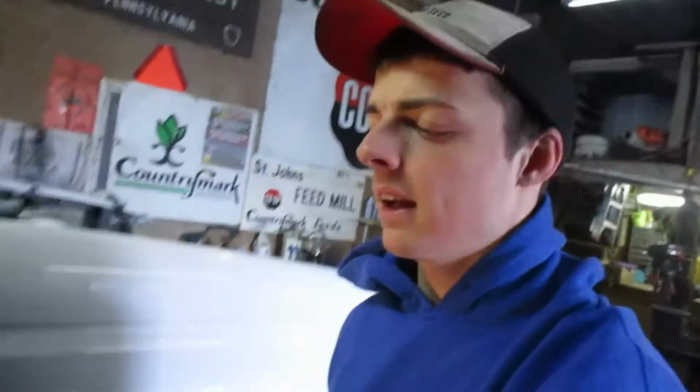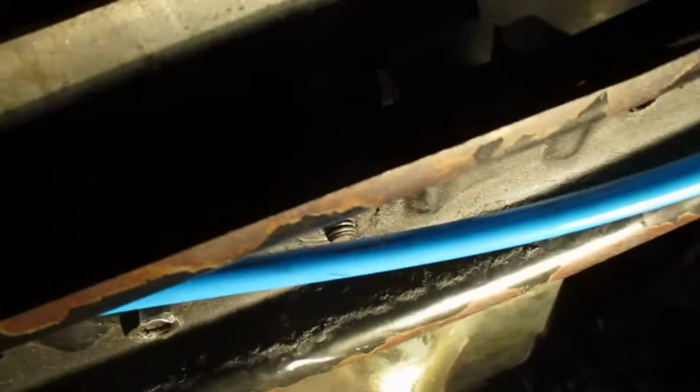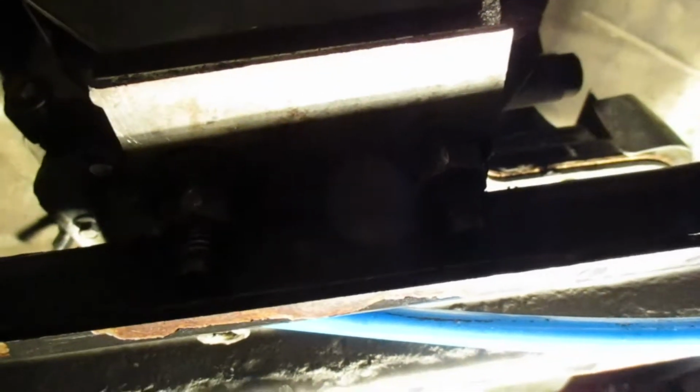Okay, so today I'm going to try to move the transmission cross member back. So I'm going to get that realigned. That way I can start mounting stuff to the motor. Well, under here, I tried to do a plate, but the transmission's, you see, I don't know if you can, where's the light at here? There we go. These bolts are offset of those. Yeah, you can kind of see it down there in the bottom left. It's kind of offset. So I gotta take this off, move it back some, strap it over, and mount it together. So, yeah. This is gonna be fun.